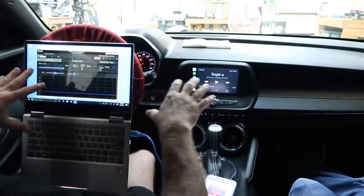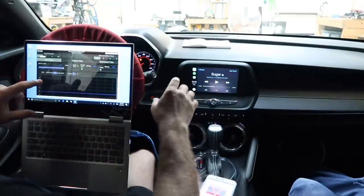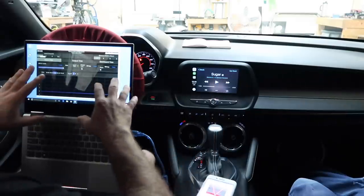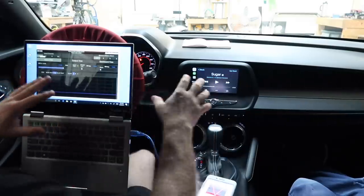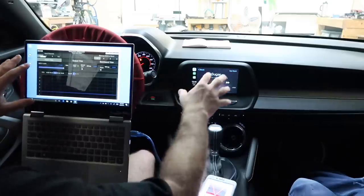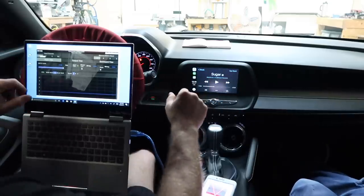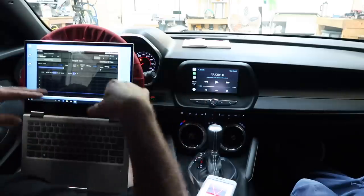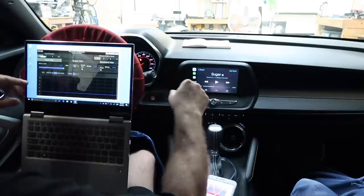All right, so playing a few songs, we've pretty much figured out that this radio is good up to about 38. Once you're playing music versus pink noise, there's a definite difference there, and 38 is definitely the number to be at. So now at this point, we can go back and give ourselves some gain, so we can bring the amps up now that we know where this output level is.